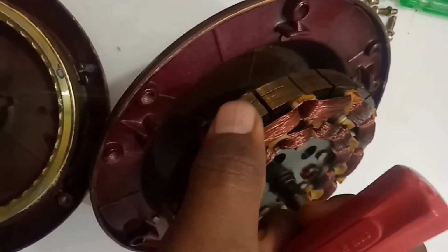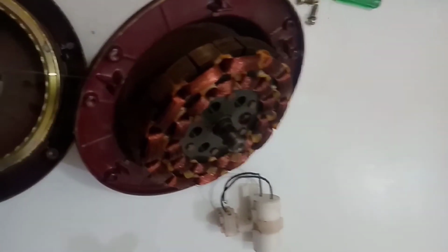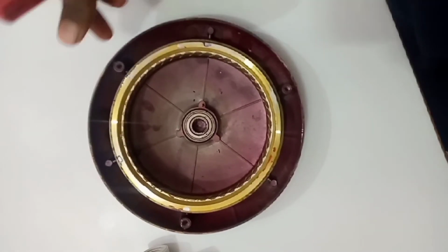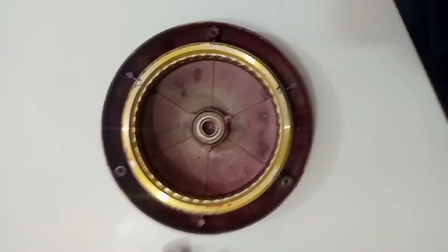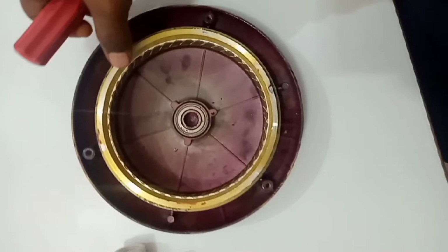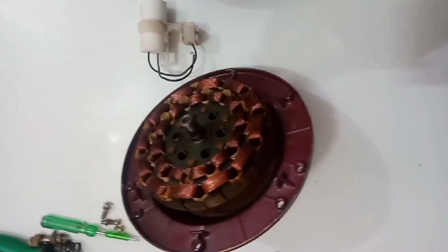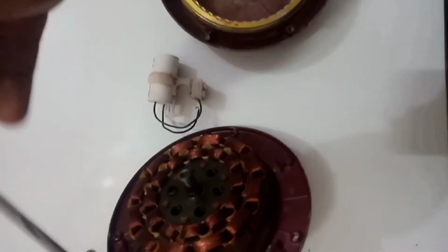So this is the whole thing, and this part that you are seeing here is called the stator, because it just remains steady; it is not a rotating part. This whole part that you are seeing is generally called the housing. Because of the two windings, a rotating magnetic field is generated. This rotating magnetic field drives this conductor to rotate, so this conductor starts rotating.